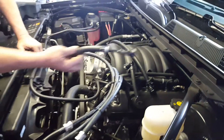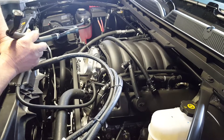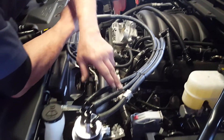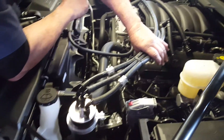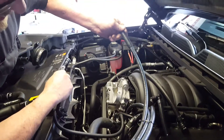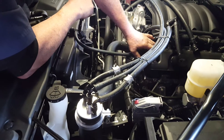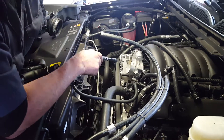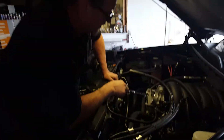The other end of this, where this would have snapped into, is going to be the primary outlet. We have check valves in line to keep the flow going in one direction, and because we're adding an additional evacuation point and source, these valves will open and close as needed providing constant evacuation to your engine. Before, it was only using intake manifold vacuum, so when you would accelerate or go wide open throttle there would be no evacuation and crankcase pressure would build at that time.